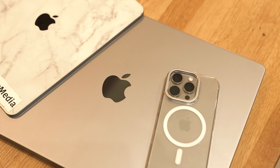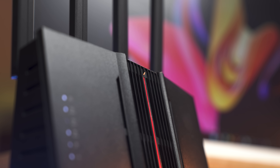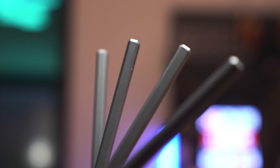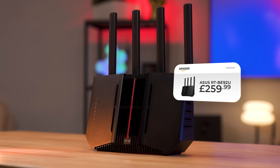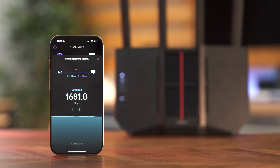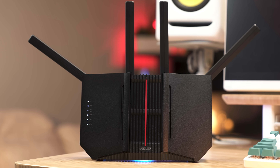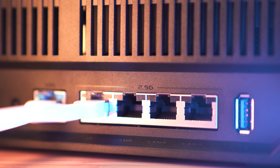Even though some or all of your devices don't support Wi-Fi 7, having the extra highway will make your Wi-Fi life easier. The RTBE92U, which we've been using for our Wi-Fi 7 tests, can be had for around £250 currently — which really isn't a lot considering the price of new tri-band Wi-Fi 7 routers. We've just been testing its Wi-Fi performance as an access point, but this is a full-on router with AI mesh capabilities, a 10G and a 2.5G LAN port on the back. I'll put the links in the description. This has been our deep dive into Wi-Fi 7 as of late 2024. I'm looking forward to 2025 where loads of devices will come out supporting Wi-Fi 7 and MLO aggregation. My name's been Alex, this has been TechFlow — see you in the next one.